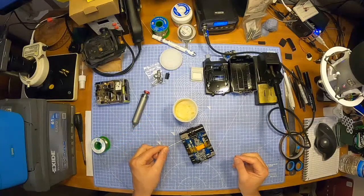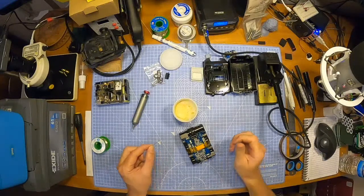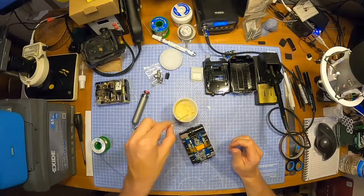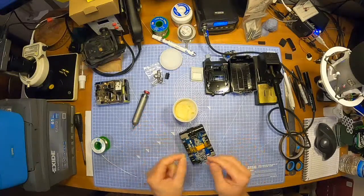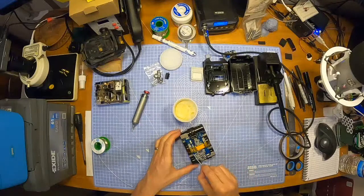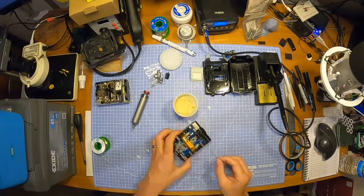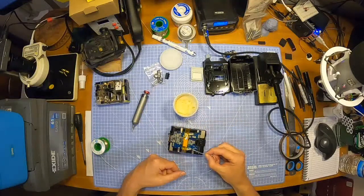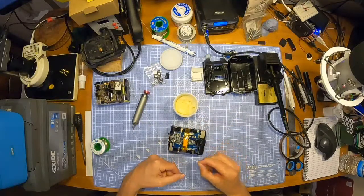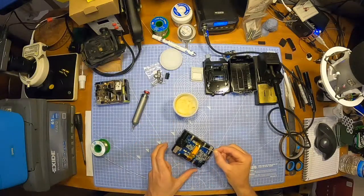Now this is not a soldering lesson because I'm not the best soldering expert, or whatever you call them, solderer in the world, but a little bit of flux on there, not too much, don't want to drown the board in it, just somewhere around that joint, just to let it start running properly. Too much, a little dab, lovely, little dab, also lovely.